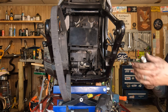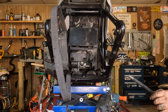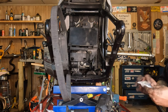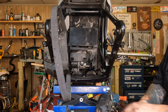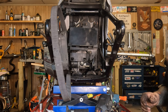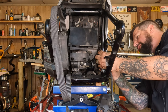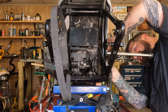So here's what we're gonna do. I'll lube up the swing arm. That looks lube, doesn't it? And we're going to start that bolt in here a little bit. Then from here, we have new inner bushings. One of them's left-handed, one of them's right-handed. It says on the package. It's due to the length. Here's the right-handed one. The big flange goes up against the swing arm. I guess you can't really see it, but I swear it goes in there.